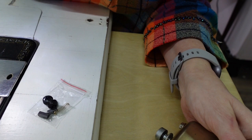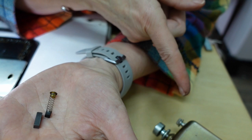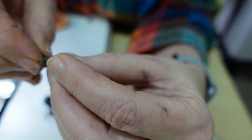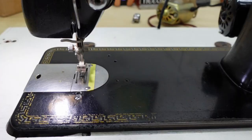Looking at the brush I pulled out, you can see how far down that part got worn down — it probably lost contact, which is likely why the motor failed. There's actually a chance I can still reuse this motor by just swapping in one of the new brushes that came with my new motor. I'll put this old motor back in my bag of spare parts for a rainy day. Anyway, I'm happy I have a machine functioning again and we'll see you in the next video — thanks a lot for watching, bye bye!